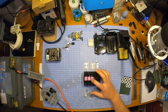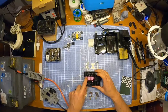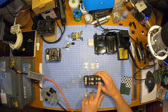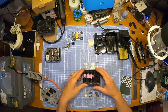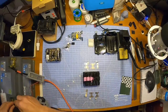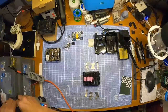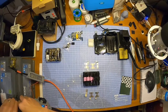In parallel is capacity. Yes. So they are 3,000 milliamp hours each, which means 3 amp hours, doesn't it? Is that right? God, I've just built a bike battery and forgot half of this stuff already. It's been a while since I put these things together. I'm just second guessing myself, that's all. Yeah, 3,000 milliamp hours. Yes, that's right. So it's 3 amp hours per cell. There's 5, which means it's a 15 amp hour pack. That is correct.